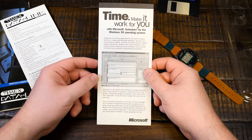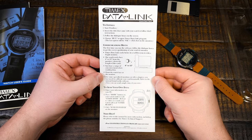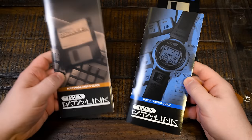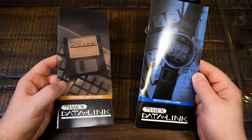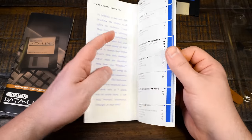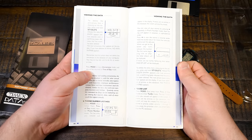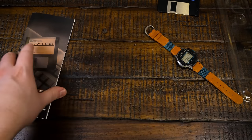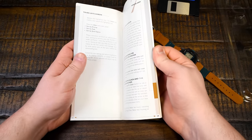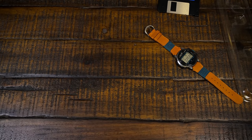As for the watch itself — it's kind of small. I'll put the exact measurements on screen. It is water resistant up to 100 meters, as indicated by the '100' marking. It also has the trademarked Indiglo electroluminescent backlighting — I was so proud to have an Indiglo backlit watch as a kid. As for the battery, behind this backplate is a CR2025 3-volt battery that's supposed to last for three years, based on Timex's estimate of the Indiglo backlight being used for seven seconds a day, one data download per day, and two 10-second alarms per day.